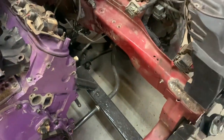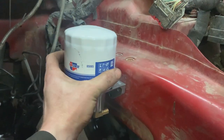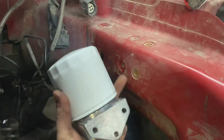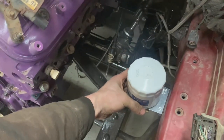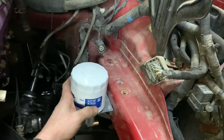See where this oil filter is gonna go, eh? I don't know if it's gonna work or not right away, but dude, you cannot beat that placement. I just gotta widen out these bolt holes or maybe drill another hole in it so they line up here, and that'll go smack right on there. Perfect. I think it won't be too close to the manifold because that's sort of over here. Sorry, lens was dirty. I think it'll bolt on perfect there.